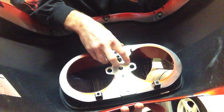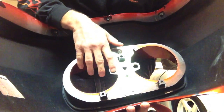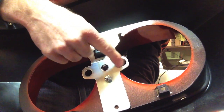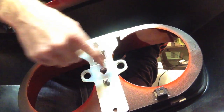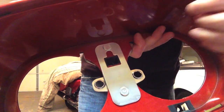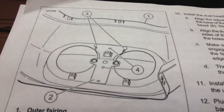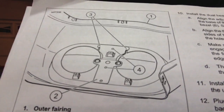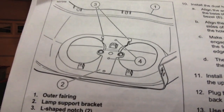And of course that wouldn't work because the tape is attached to the other side. So I went ahead and put it on here the way that it is after looking at it in some videos, and the best I could tell, this is the right way. The other part of this that makes you believe that the drawing is wrong is, notice right here, these holes which are punched through. They're punched through on the non-sticker side, and they create a flange that protrudes on the side that had the sticker, the side that is adhered to the back of the fairing before I put this clamp on. When you look at the drawing one more time, at that clamp when it's installed, assuming that sticky side is already on the inside surface of the fairing, those protrusions are coming inside the fairing to where it looks like they were punched from the nose of the fairing, or the outside surface. And again, that's backwards from the way that it is on there now, based on where the tape was.